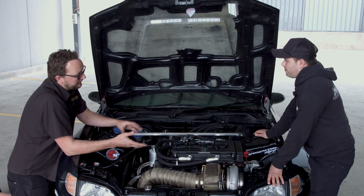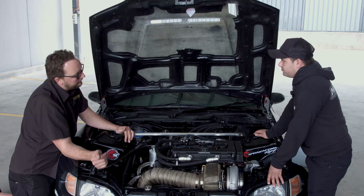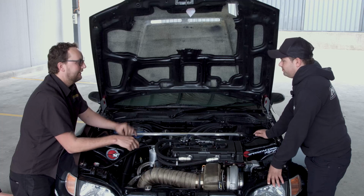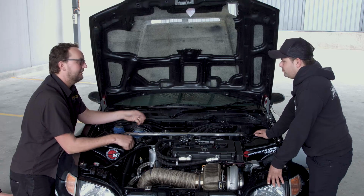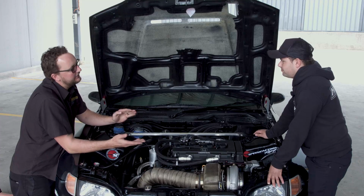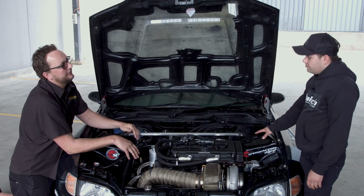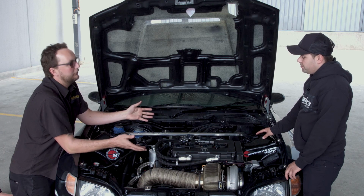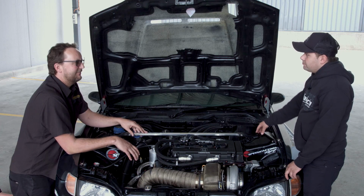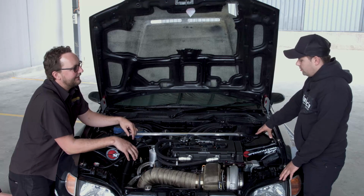Yep. And what you've sort of said there is that if it's got 65 pounds of base fuel pressure, if we put 50 pounds of boost in, the fuel line pressure will end up at 115 psi. The pressure across the injector stays at 65, but if it falls down 10 pounds less to 55, there's simply less fuel going in the engine. So definitely, the tune is going to be different, and that's when a meltdown happens. So I'm pleased that the engine protection has sorted it out once or twice.